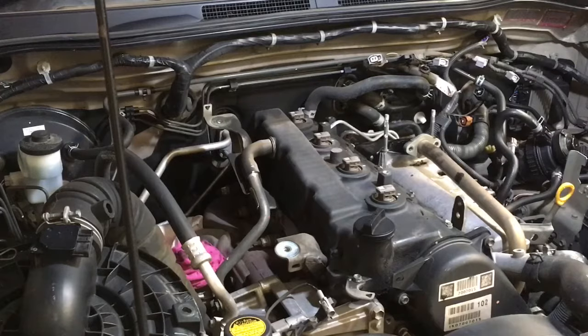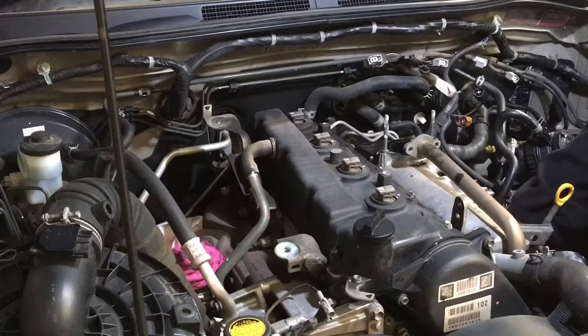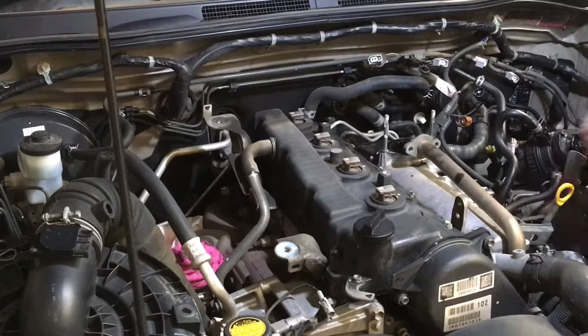Okay, so number three pipe off. Dirty, corroded old number three is off. Get another one of our caps and put it in place. I'll give you fairly quick, you don't need caps if you're just doing the injector job, and you're only going to have it apart a reasonably short period of time.